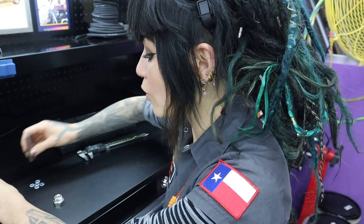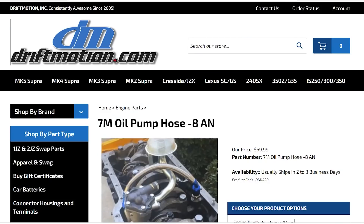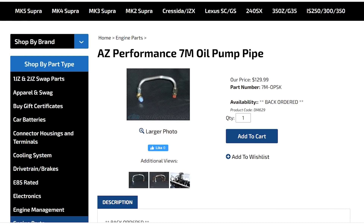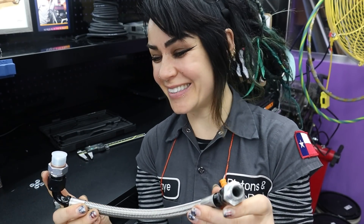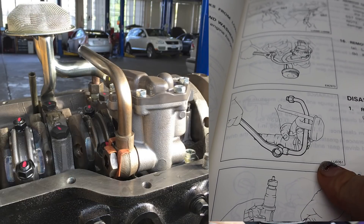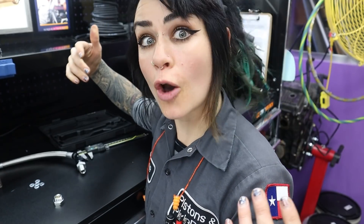While you're here with the oil pump out, there's another major upgrade that will help with oil flow — not necessarily pressure, but flow. The factory oil line at the bottom of the 7M is extremely restrictive and has a very harsh 90-degree banjo fitting. This upgraded braided oil line is also available on the Drift Motion website; Arizona Performance also makes a hard-line version. This combination I think is a perfect fit for a nice OEM-plus build.